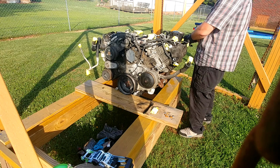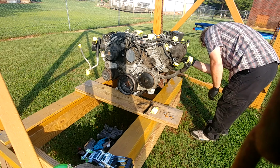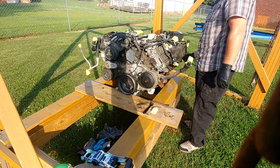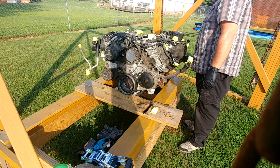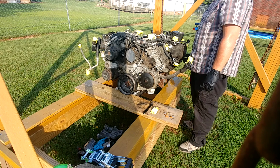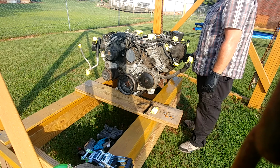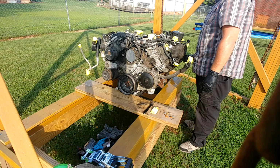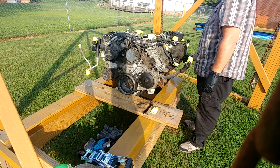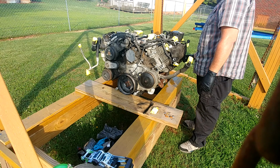They got the cooling system, and now all of a sudden, the truck does crank, but it is a very long crank. We're talking a good 10, 12 seconds for that engine actually to fire off. Then once it fires off, we have no RPM signal. Accelerator don't do nothing. It thinks it's, I don't know what it thinks.